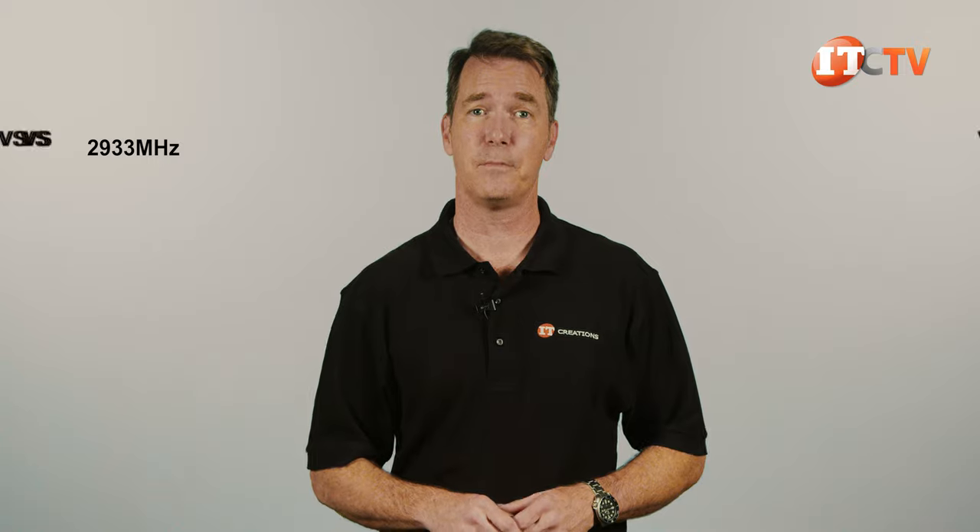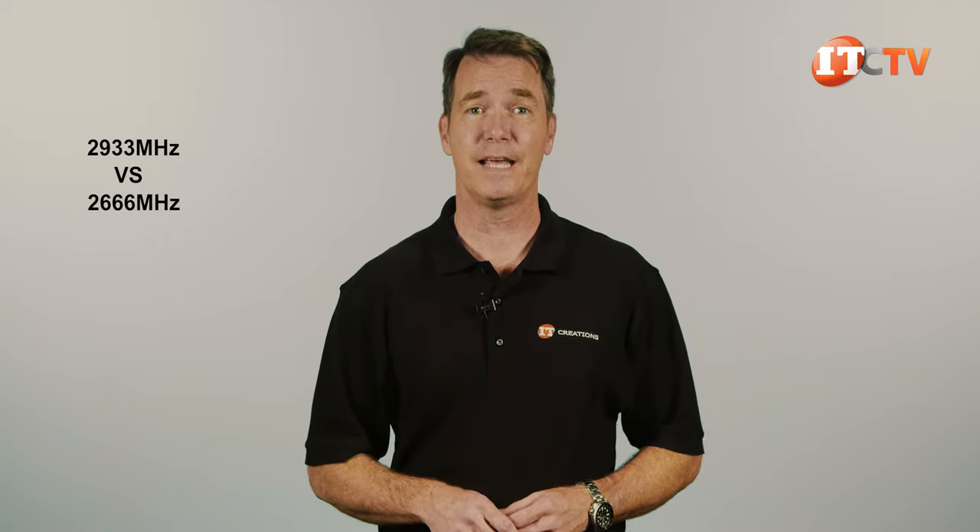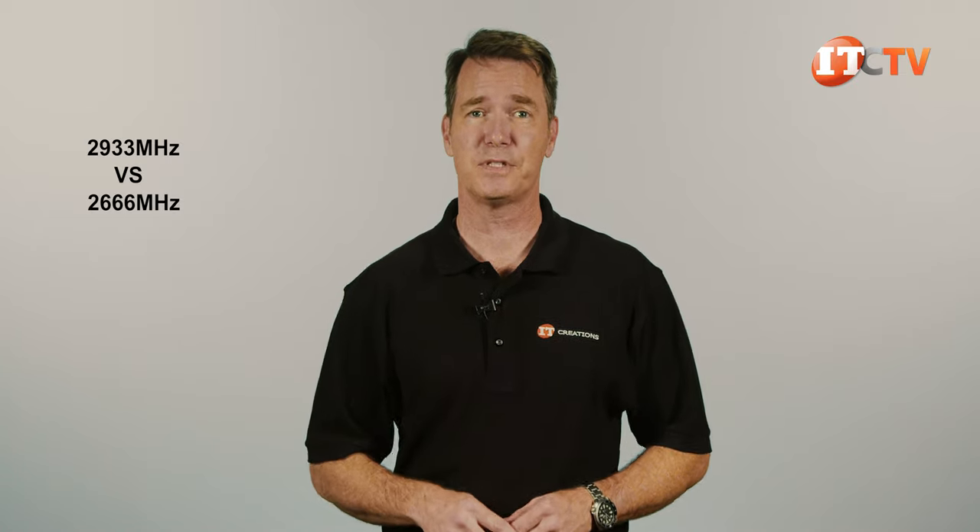I'm not sure why the manufacturers are not making more of a fuss out of this new processor. You get more cores with similar model numbers at the same price point, basically — an improved clock speed plus increased memory capacity and speed. Memory speed on Gen 2 processors now clocks in at 2933 MHz instead of just a paltry 2666 MHz. They now support 256 GB memory modules, including Optane DC persistent memory modules, but that's another video.